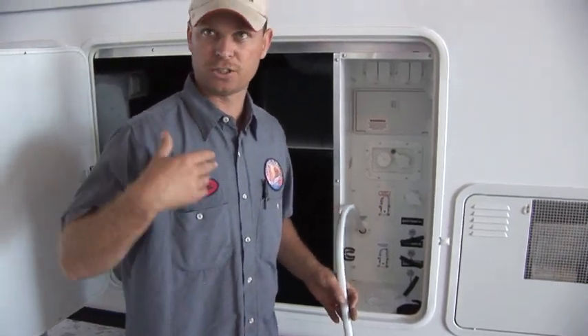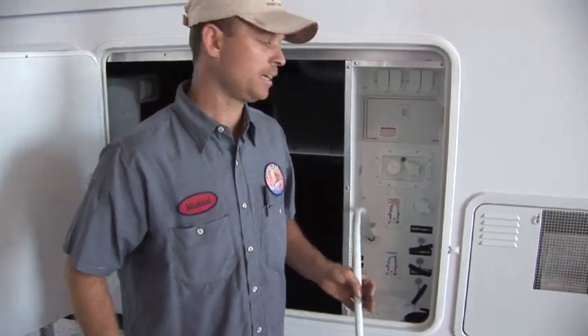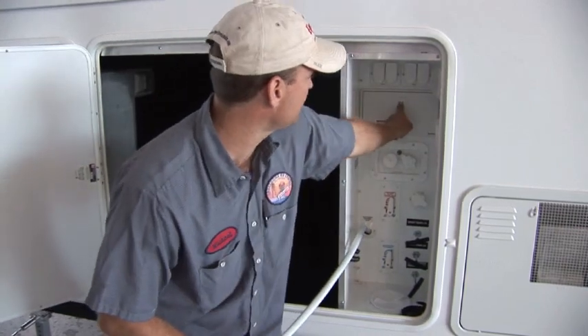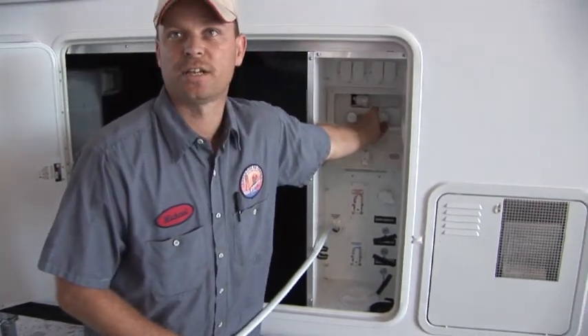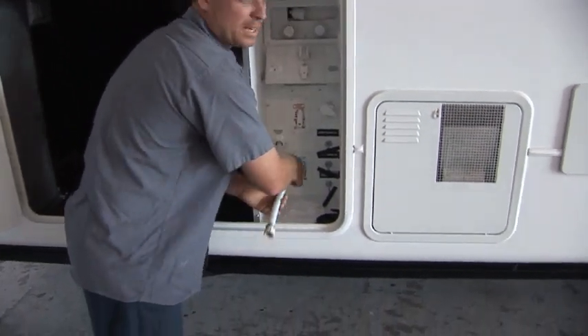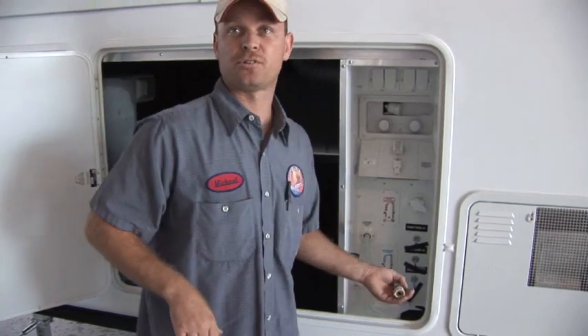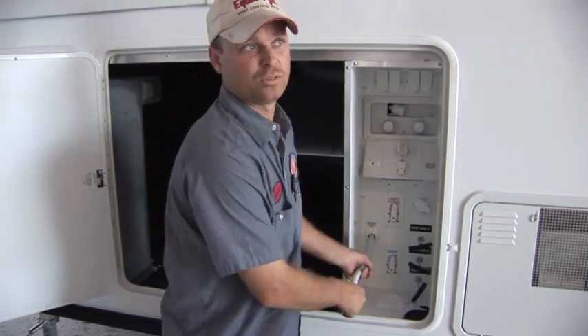You flush your toilet until you start to see pink stuff come through. You run your shower and hot and cold water on the kitchen sink. And if you have an outside shower like this one, you come out here and make sure that you don't miss that. You also want to pour some down the traps — maybe the remainder — you want to drain it down your trap lines. So dump a little bit down the kitchen sink, bathroom sink, and shower drains.